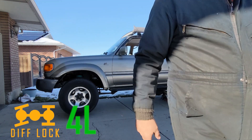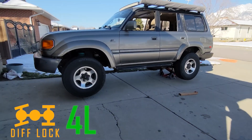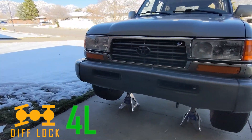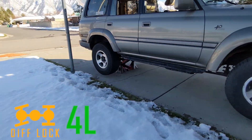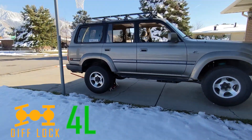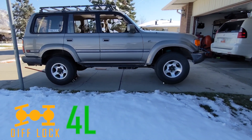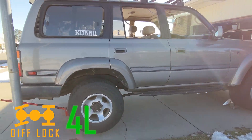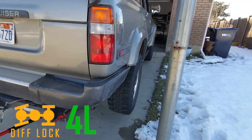See that? Now they're perfectly synchronized. All four wheels receiving the exact same speed — not torque, speed. This means there's no longer a speed bias in the differentials because there are effectively no more differentials. I have taken differentials out of the equation. This would be like a Lego car, just straight axles — power straight to the wheels, for good or bad.